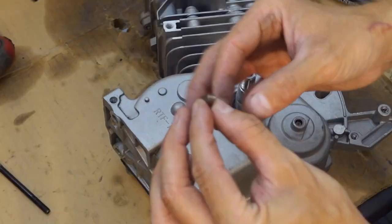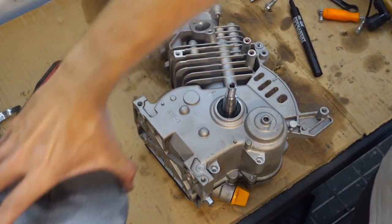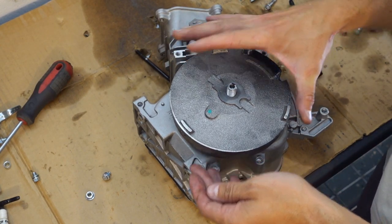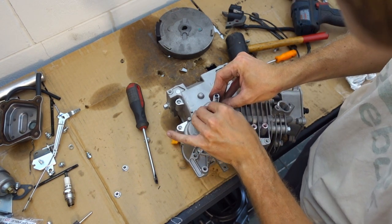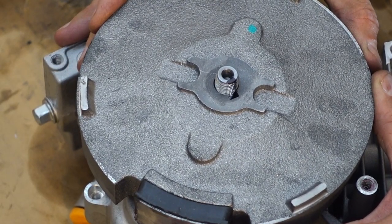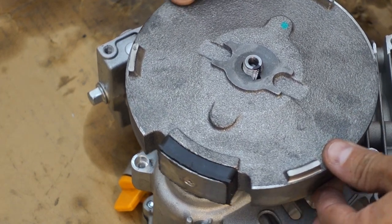What I'm going to do is file down this key — I'm going to take it down about in half, which means I'll file down the left side of this key to create an offset on our flywheel. Once we put our flywheel back together, the timing will now be advanced. My goal for this was about a 10 to 12 degree advance, and I think that's going to give me just about 10 degrees right there. You can see our original timing mark was there, and with the ground-down key the flywheel now stops here — that difference in rotation is our advance.